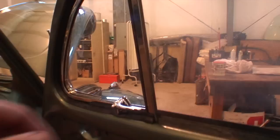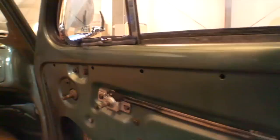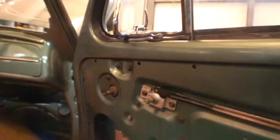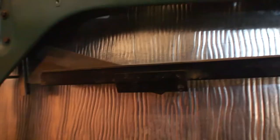Here are the inner scrapers, and again the inside of the vent window. You can see that the vent window opens and closes nicely — you won't have any whistling down the road as you're driving. We'll work with the regulators, getting those in correctly to get the window in. Some of you might have the door catch mechanism for the door pull out before you install. We put ours back in after we had our doors gutted. As you can see, the window rolls up and down nicely. Lift channels are good on the glass — they do sell these new if you have to get them, because sometimes they're pretty rotted.